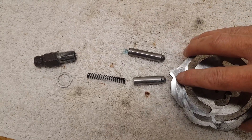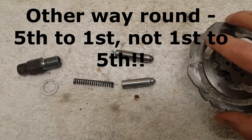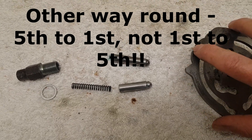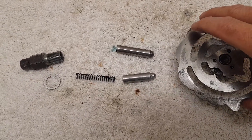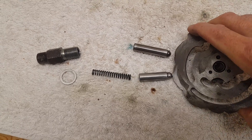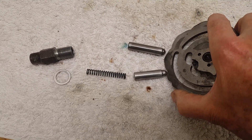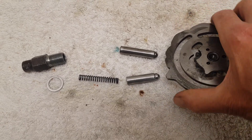So that will go in there — that will be first gear, then neutral and second gear, third, fourth, and fifth. As the cam plate moves around, these plungers run and lock when it comes to a little dent, and that's what locks it in gear and stops it from moving on to the next gear.